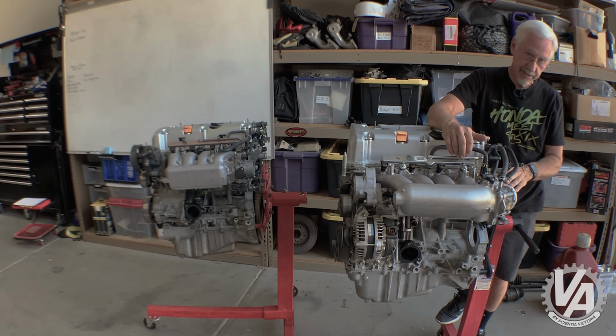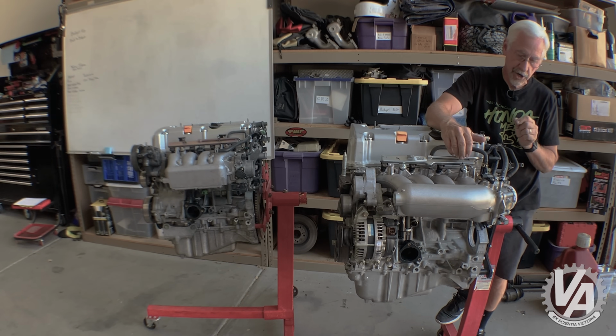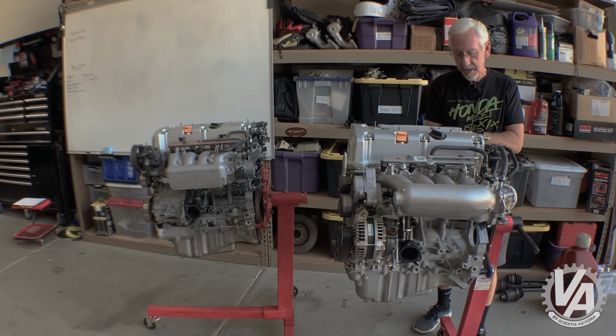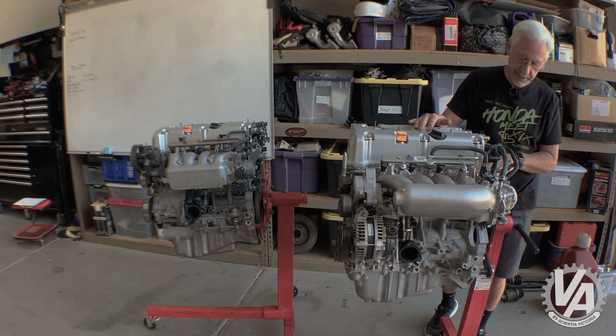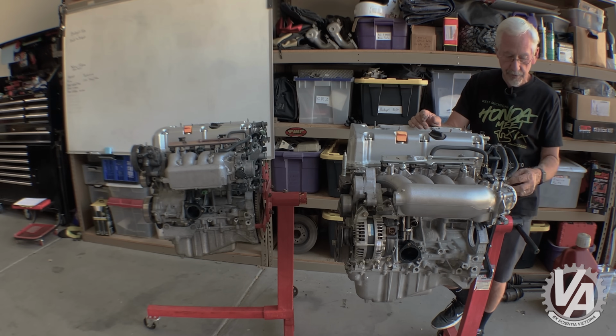It's actually on the side of the engine over here, and it comes out at about a 45-degree angle. This manifold that this upper outlet is on also has the ports for the EGR. Now, EGR is not present on the 2-liter motor in the Civic Si, at least the EGR valve is not present, but all the porting's there. So if you feel inside this back port right here, you can feel the opening for the hole for the EGR, and then it's blocked off with this block-off plate right here.